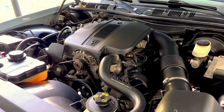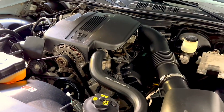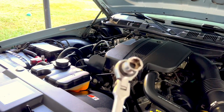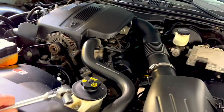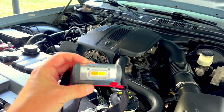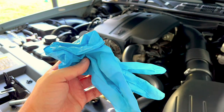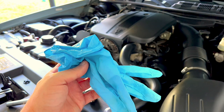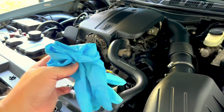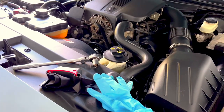Let's get into what you need to do an oil change on a Crown Victoria from 1998 to 2011 — I'll leave links to everything in the description. First, you need a ratchet with a 16-millimeter socket. I've also got a headlamp — this is a Scan Grip — to help me see underneath the vehicle. I like to wear gloves during oil changes to keep my skin protected from the oil.